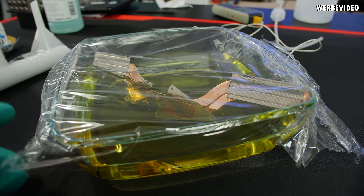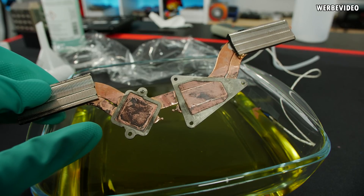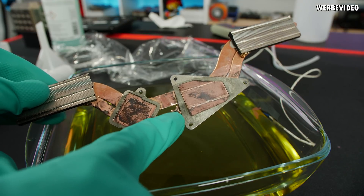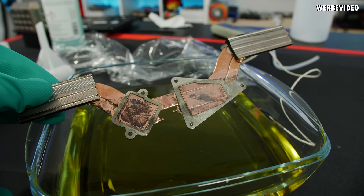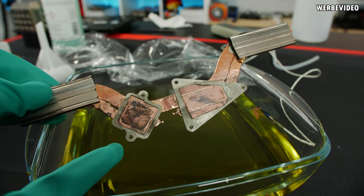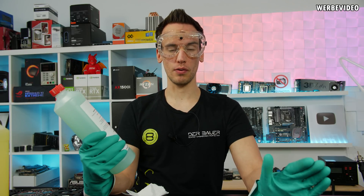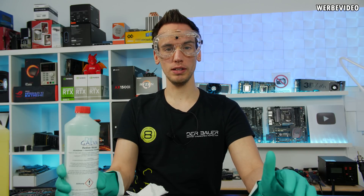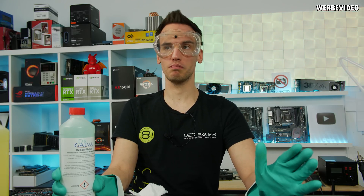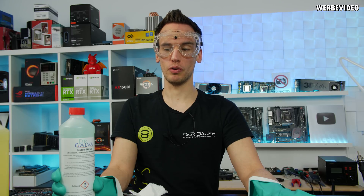Time to look at the result of the palladium step. Honestly, I'm not 100% sure what to think — it doesn't look that great, and I'm not sure if the surrounding aluminum material is causing negative effects. But we'll continue to the next bath, rinsing with clean water first. For the final step, we'll use the nickel electrolyte solution in the oven for about four hours at 70°C, which builds up approximately 2.5 micrometers per hour — targeting at least 10 micrometers, ideally 20, but four hours for a first test.